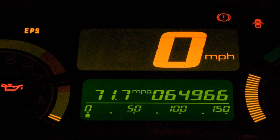In the case where a new 185/70R14 tire of 620 mm diameter will have approximately 8 mm tread depth, at the legal limit this reduces to 1.6 mm, the difference being 12.8 mm in diameter or 0.5 inches, which is 2% in 620 mm.